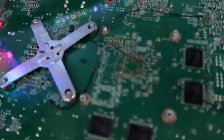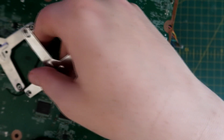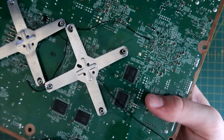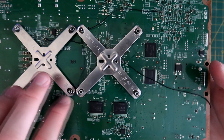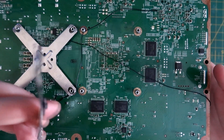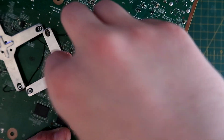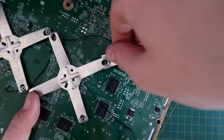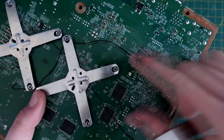For the second heat sink, flip it around, hold from the bottom, and watch any RGH wiring — make sure you're not clamping it down. If the corners aren't clipping down, it's probably because the clamp is bent a little too far outward. Use the X-clamp tool to pull out and then push in to clip it on. The final corner clips on the same way, and that's the X-clamps installed and the thermal paste replaced.